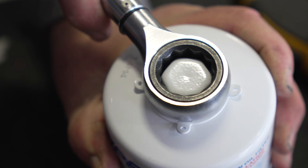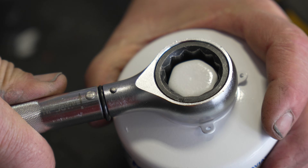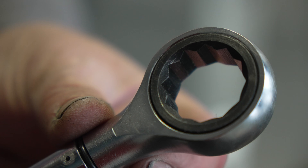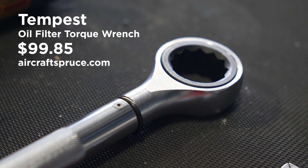We call this a lollipop wrench — probably not its official name — but it's an oil filter wrench, and it's a ratcheting box end. You put it on the hex of your oil filter and it ratchets, so you can turn it in tight spots, because sometimes you have very little space between the back of an oil filter and the firewall. This is only maybe three-quarters of an inch thick, and you can tighten and loosen your oil filter easily. When it comes time to tighten it to its final torque, it has a built-in torque wrench preset to 17 foot-pounds — just perfect for tightening oil filters. Because it's a box end, it grips all six sides of the hex. People use adjustable or open-end wrenches and invariably wrench apart the flats on the hex of the filter, and then it becomes a nightmare to remove.